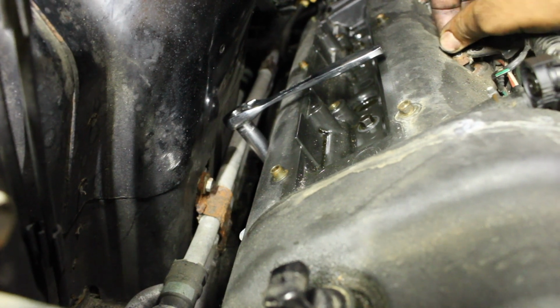And these down in here, these bolts are super tight, but once you crack them free, they're loose. I do not believe, I'm going to say it now, but I do not believe there's a torque spec on them. They have like a built-in metal shoulder, so once they bottom out, they're done. There's no need to keep going.